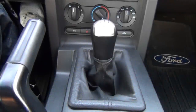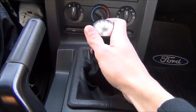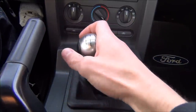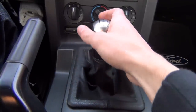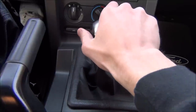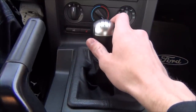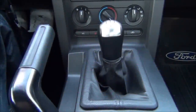That sequence would be a typical driving sequence going from first straight through to fifth as your speed increases. To summarize each gear from neutral: first is left and up, second is left and down, third is straight up, fourth is straight down, fifth is right and up, and reverse — the only way to reach it — is right and down from neutral.